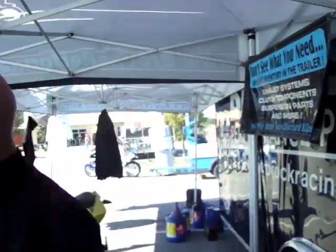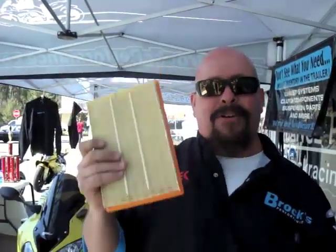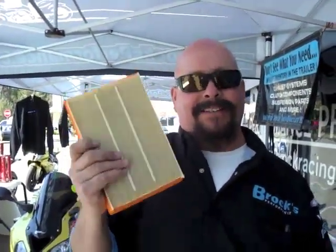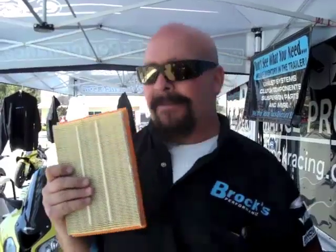The first thing we're going to do is remove his aftermarket air cleaner. It's a gauze-based street filter. We know from our own testing that gauze-based street filters typically get over-oiled and don't flow as well as stock. We're going to put the stock BMW air cleaner back in. BMW engineers spent millions of dollars to make sure this is a great product, and we believe it's a great product.